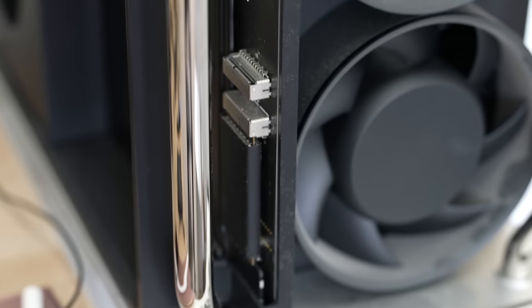There are so many ribbon cables here, I really hope I don't mess something up. Looks like I have to take the SSD off to access the USB-C ports on the front — this thing is literally taped on and they don't want you to remove it, but we have to. Sorry Angelica, your Mac Studio is getting surgery. What if I just put it into the other slot so it's not in the way of those ports? Plug it in, tighten it down — cool.